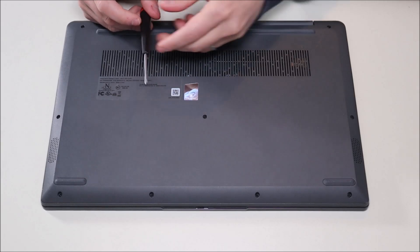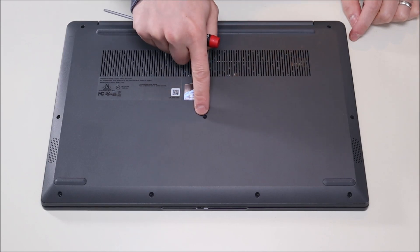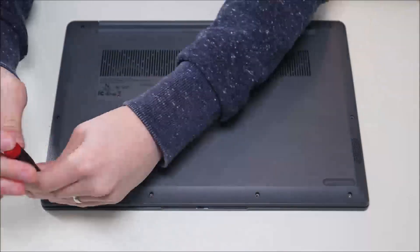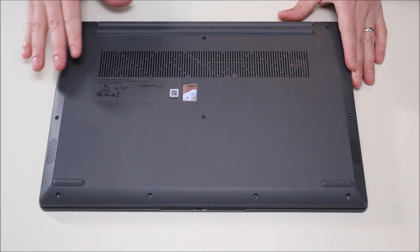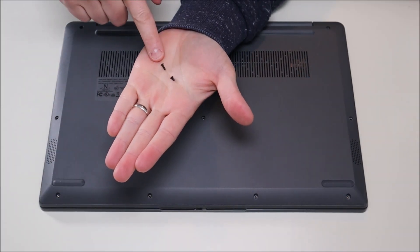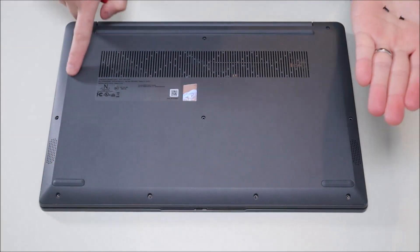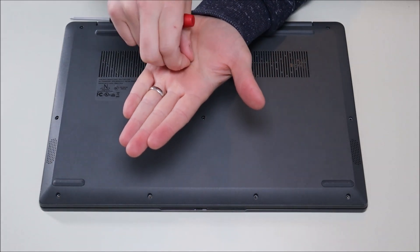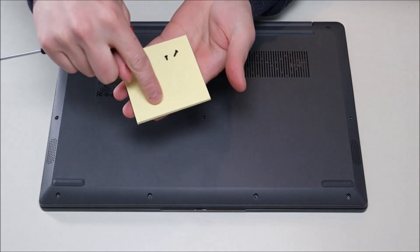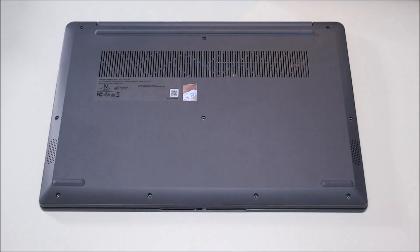Now I'm going to take my screwdriver. As you can see, there are four screws along the bottom, two on each side, three along the top, and one in the middle. I'm going to go across and take those out now. One quick note when you're taking screws out: make sure you keep the same size screws together. I had a large screw — a long one — and then a short one. The short ones went across the front, the long ones went everywhere else. So make sure you know which screws go where. Sometimes I even put them on a sticky note and write down where the screws went, so I know I'm not going to put the long screw into a small screw hole.